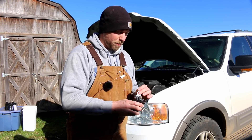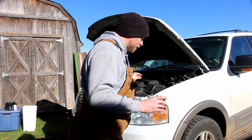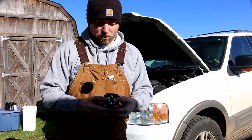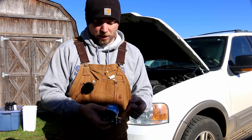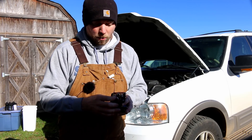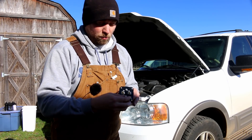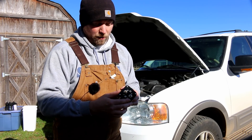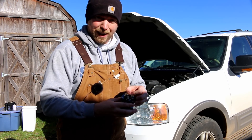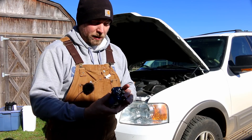I'm going to read the instructions on this one just to make sure — I've already read them twice. What you have to do is bring your positive lead in here and your positive lead out — two separate connections that separate the circuit — and inside is the switch that connects or disconnects them. Then you have a ground and a 12-volt signal wire that lets it know if the vehicle is running. We're going to have to find a wire in the vehicle and connect to it, and also make a custom wire to connect to the alternator using crimps.